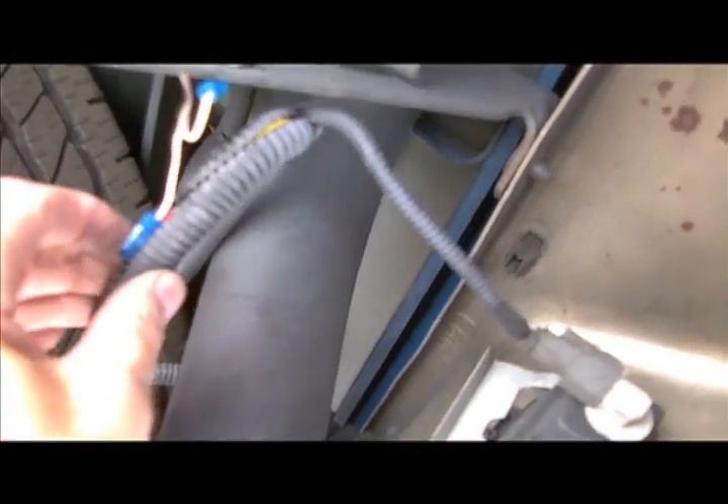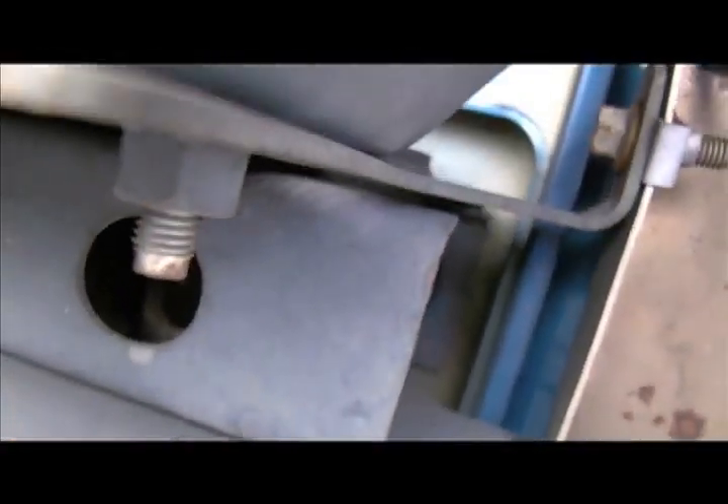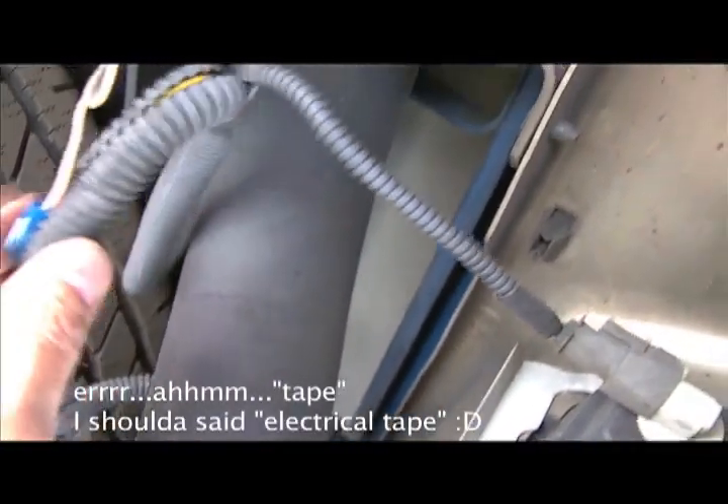Here's our wiring solution. I used a line splicer on the hot wire. Instead of using another line splicer to get into the ground inside the harness — there's not a lot of room — I decided to ground it externally. I got a bolt with a wire ring terminal, added a lock washer and some thread locker to make sure it stays grounded, and then I'm going to tape it with electrical tape to cover it up. Now let's go up top.